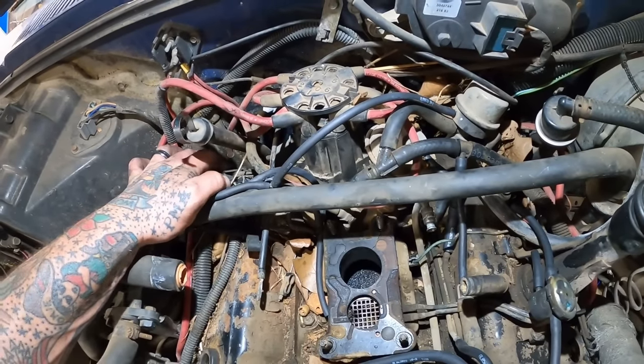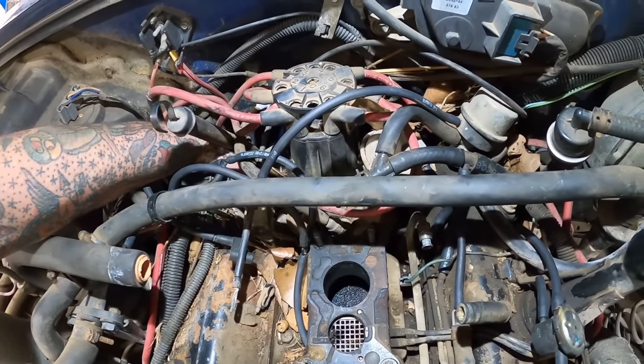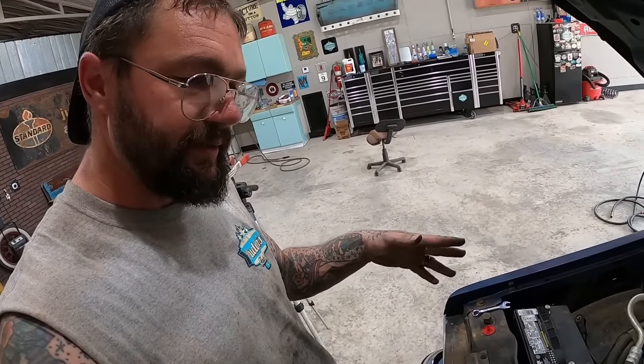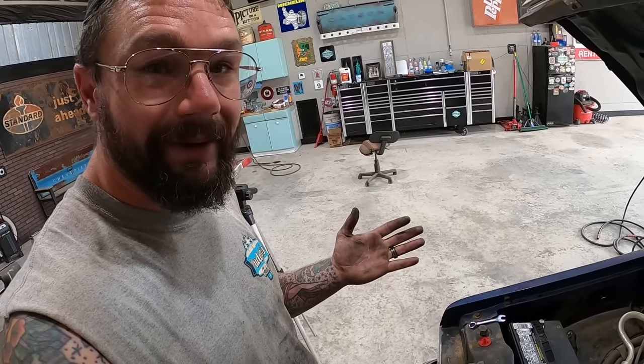But I was wondering where the distributor was feeding. And it's somewhere here on the bottom side the hose sticks up, and it was barely hanging there. So it was cracked pretty good, and as I touched it, boop, vacuum hose just fell down. So that could be some of our bogging right there.